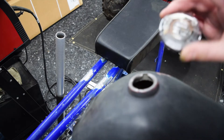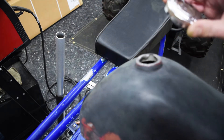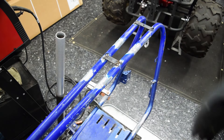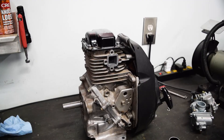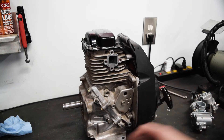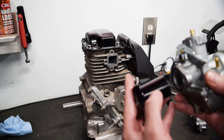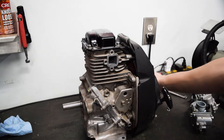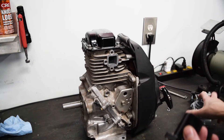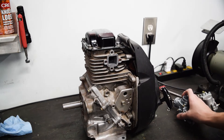What I did is I ordered a sheet of quarter-inch nitrile, which is fuel resistant, and I'm just making my own seal. We're really making headway — at least I'm telling myself that. I think I got the intake stuff figured out finally. This was the intake we were using originally — the double flange, which required a flange-style carb. I didn't really like it; there wasn't a whole lot of options for clocking the carb. So I shortened it a little bit and we're going to go to a spigot mount, then use a rubber hose to connect the two together — a little more smooth and a more refined result.